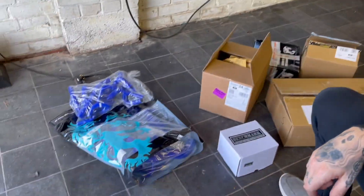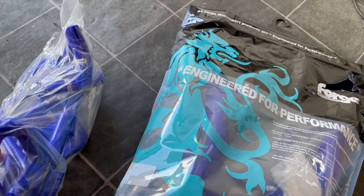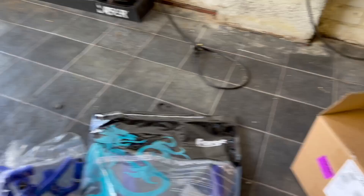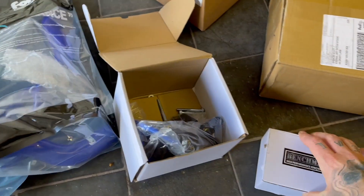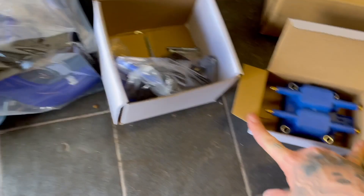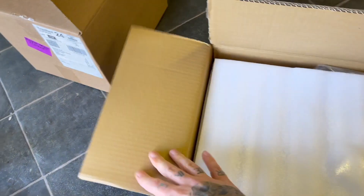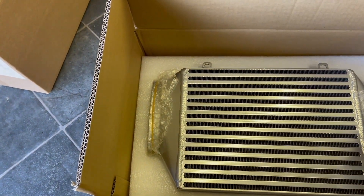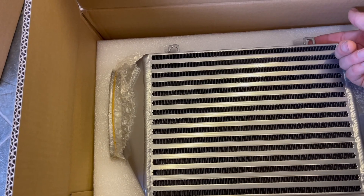So that was the car in pieces at the garage — couldn't film too much as I didn't want to get in the way. In the meantime I've got a parts order. I've gone for the Forge blue silicone hoses and the Pro Hoses auxiliary kit with clips. I've got a coil pack from eBay — got some good reviews. And it's all blue, so it all matches. I've also got a new MTC intercooler, and some rubber grommets to go under here, because these can snap off if it's metal to metal.